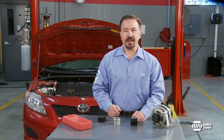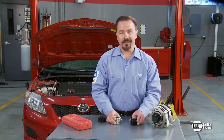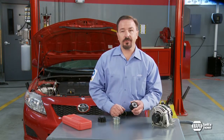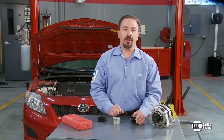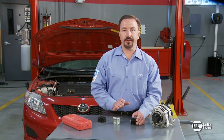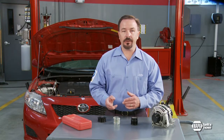In 1997, car manufacturers designed systems with a one-way clutch pulley. And then in 1999, the more advanced overrunning alternator decoupler pulley. These pulleys allow for the alternator to freewheel or coast during deceleration. They lock in one direction to power the alternator but turn freely in the other.